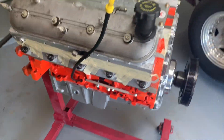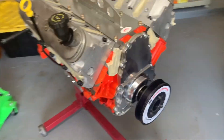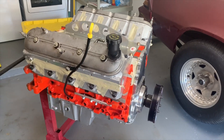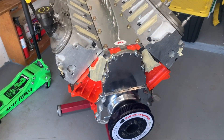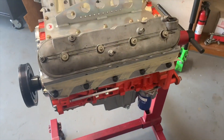The heads are installed. The valve cover is temporary just to close it up. This morning we just did our push rod length check with our ZZP push rod length checker, and it came out to 7.425 inch. So that's with our current setup with our KMotion cam and our 660 lift valve springs.